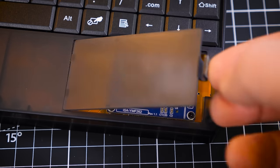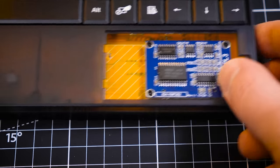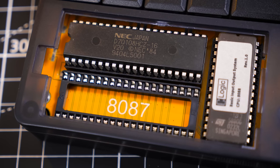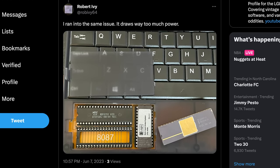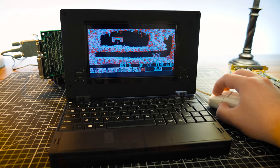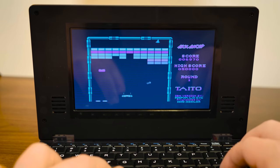Of course it already has a more suitable choice — that OPL3 card — which plops into the bay on the right, with three more sockets over on the left housing the CPU and the BIOS. That's also where an optional 8087 Math CoPro would go, but I'm not doing that. Some folks state that it runs hot to the point of concern, possibly from being tightly packed in that plastic case. Otherwise the system overall works well for what it is — the fact that it's using legit old chips for processor, DMA, timers, and controllers makes it amusing to watch do its thing. Like an HP 200LX that grew up, went off to college, and came back with a full-color display. I just wish I could see that display without waiting till daggum midnight.